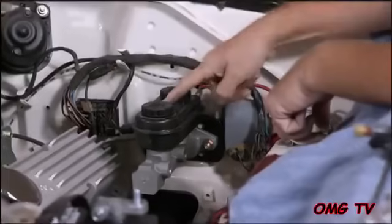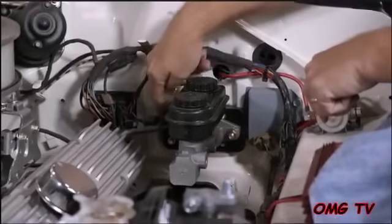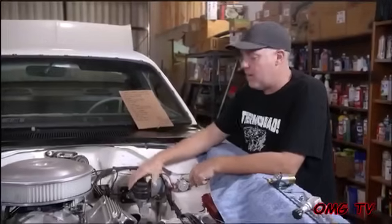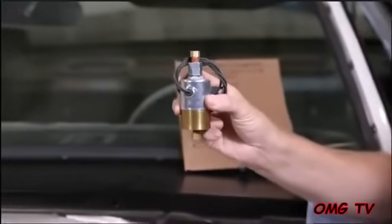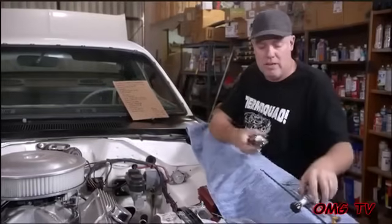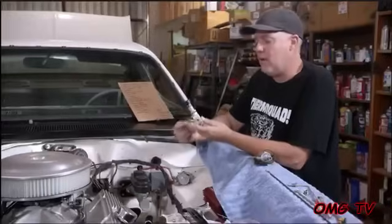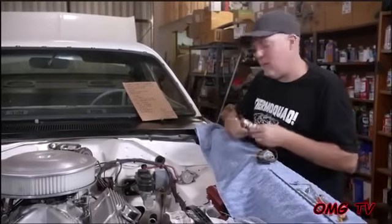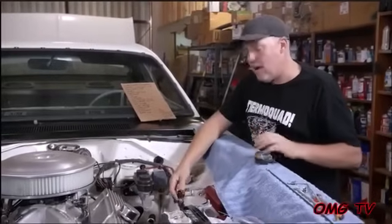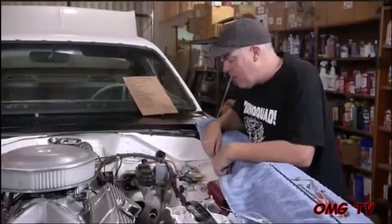I got assigned to plumb the brakes in the whole front half of the car, which is going to be a giant nuisance. We converted to a late model aluminum master cylinder, replacing the big iron one that would have come stock. We've got a Mancini Racing adapter block that offsets the master cylinder to the outside of the car for more clearance to the engine. I need to install a line lock — when you step on the brake pedal, it holds pressure to the front brakes but not the rear, so you can do burnouts. I also have to install the adjustable proportioning valve in the rear line, which adjusts brake pressure so the rear brakes don't lock up before the front, which would make the car come around. The problem is figuring out where to mount all of this and how to plumb it without getting lines absolutely everywhere. I've got hours of frustration ahead.